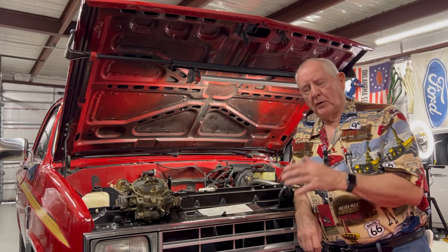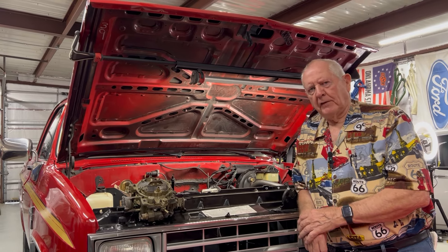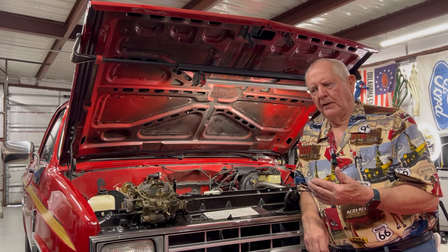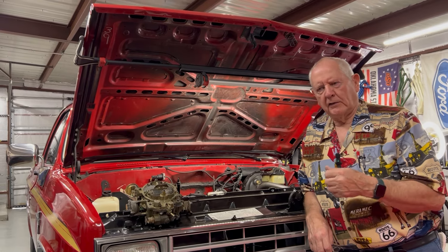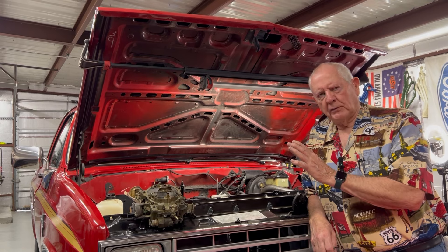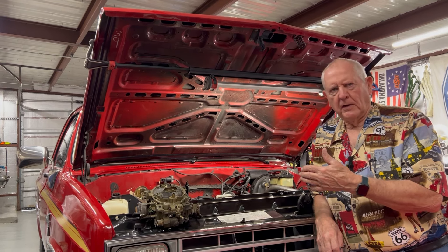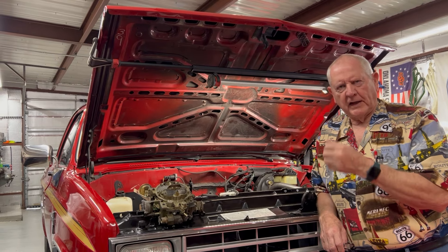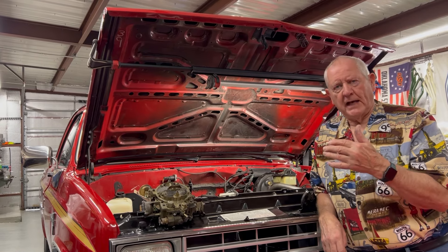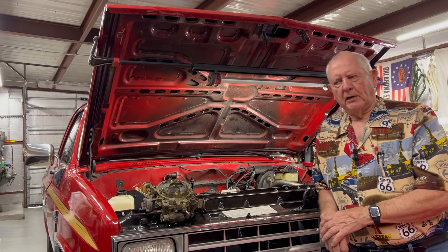The other issue we're dealing with is that when you go down the road and put your foot on the brakes hard, the back end locks up — the rear brakes lock up. That's probably the proportioning valve. We ordered one to fix it. We did take the rear brakes off, checked the drums, and turned them because they were a little out of round. When you stop normally there's no problem; when you have to stop quickly, the rear wheels lock up and squeal. The proportioning valve holds off the back brakes when you're stopping, long enough for the front brakes to engage first. Without it, as the vehicle's weight shifts forward, the rear loses traction and the wheels lock up — what we used to call a fishtail. We're hoping the proportioning valve will fix that problem.